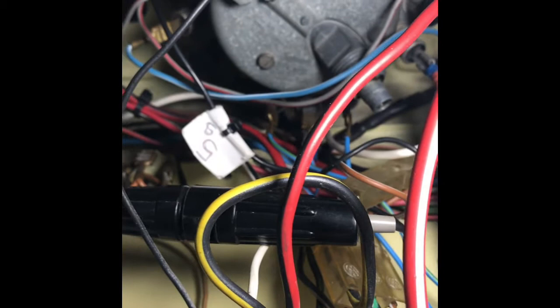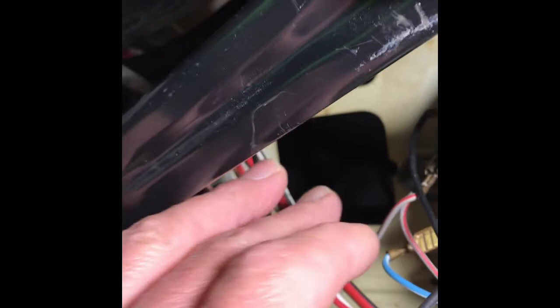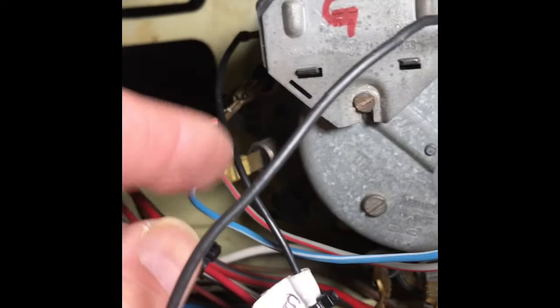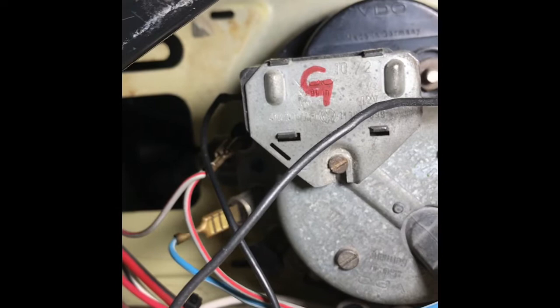Last, we're going to address terminal 58B, which is a thin gray wire with a red stripe connecting to terminal L10 — that's this little wire right here. It's a gray wire with a red stripe connecting to terminal L here and terminal L over here. You can see that wire has a tiny splice, which is a connection of two wires into one single port. That completes the installation of your light switch.